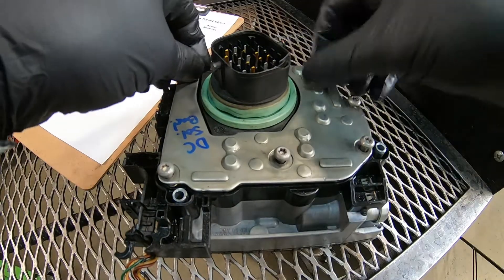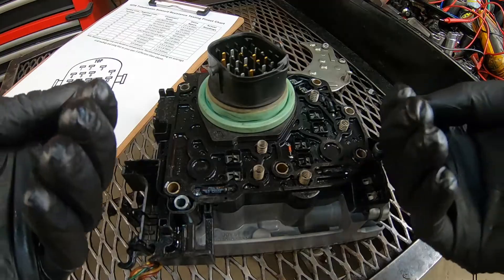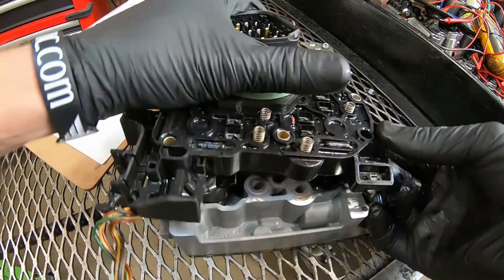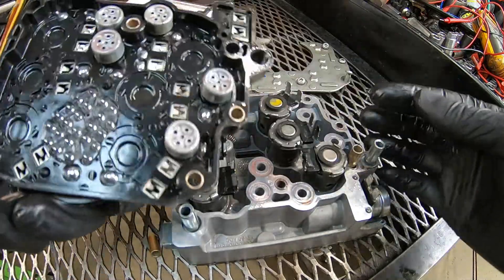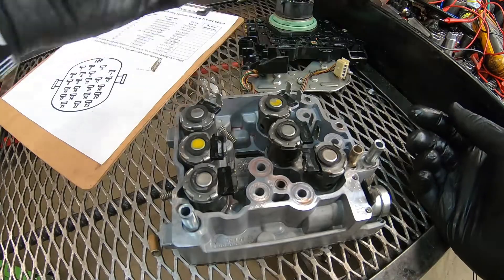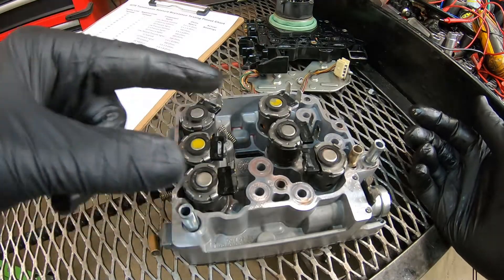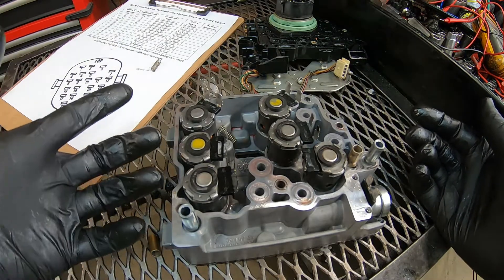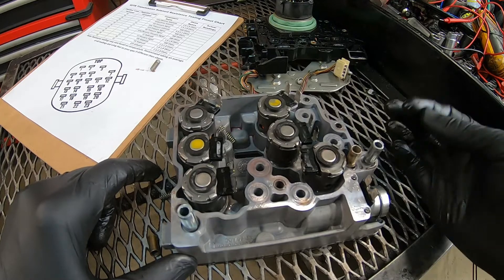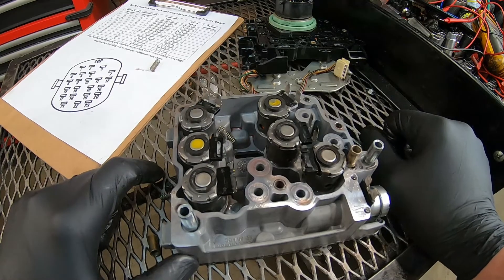Once you remove the fasteners, the plate just comes straight up. Then you've got the plastic portion — it's kind of the circuit board of the solenoid pack. All the solenoids come in through the bottom of it, and the pressure sensors are mounted to the bottom as well. On the back side, you can actually see the pressure sensors, and over here you can see the solenoids. Physically, they are removable — you can pull them up and take them out. On different transmissions, mainly in the trucks, they have O-rings you can replace, but you can't replace solenoids. In a perfect world, you'd buy just a solenoid, replace it with new O-rings, and put everything back together. But unfortunately, you're getting it as one part.